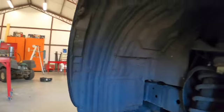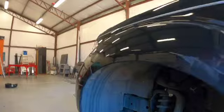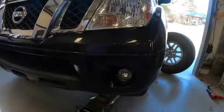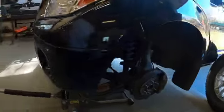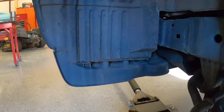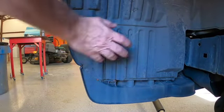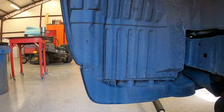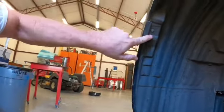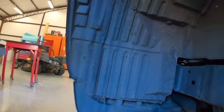Okay, so what we're looking at now is the wheel well. You can see the light is right there. As we go around inside the wheel well, I'm going to start removing some little screws so we have access. These are Phillips head screws — there's one right here and one here.